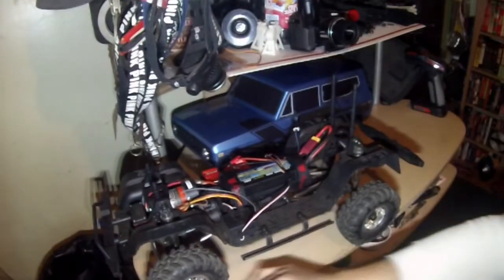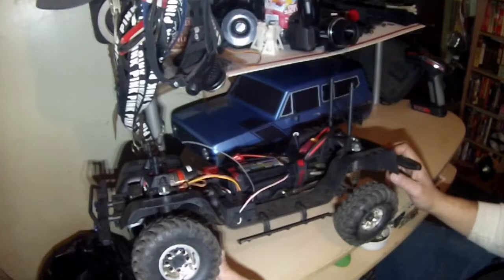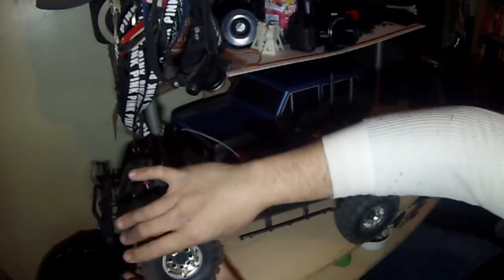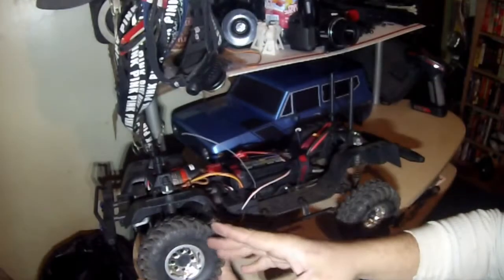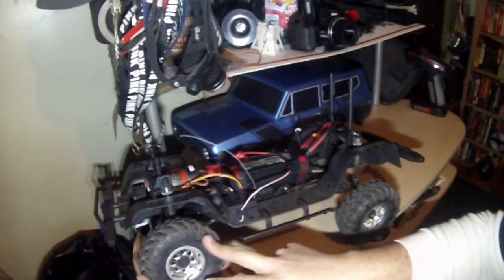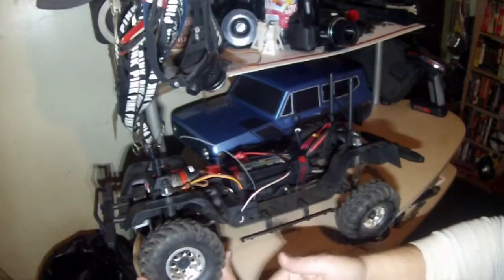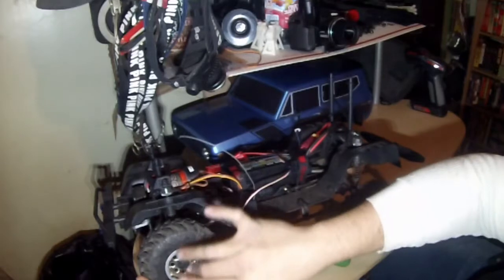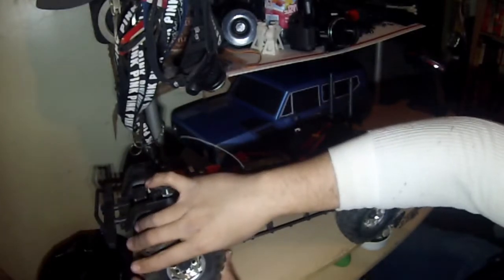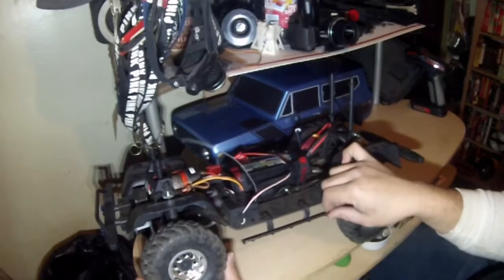They do come with real beadlocks — Super Swampers, 1.9s. They are nice. The only thing I don't like is the rim has a small hole drilled in for air, and you can actually hear air coming out. The problem is when you go through water, that same hole lets water in. I've used this in really cold weather and the foam inside froze solid, making the tire like a rock. On my other truck the rim is sealed so they flex but there's no air getting in or out, which I prefer.